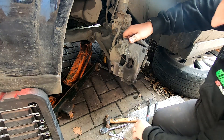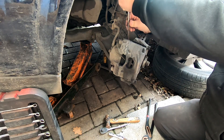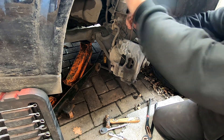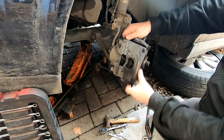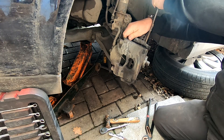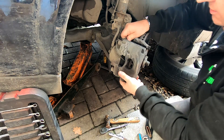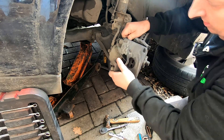This should hopefully now - you might have to give a bit of leverage to this just to push the pistons back in. Because as I say, there is a lip on this. And I'm just pushing the piston in gently now. I haven't removed the master cylinder lid. I'm just pushing it back a little bit and hopefully we should be able to get enough to get these off.